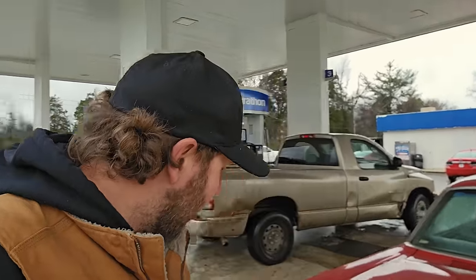Going pretty sweet. Headlights are hanging in there. Taillights are hanging in there. I just got to remember that these are hot wired to the battery in the rear. I got to pull the new headlight switch, but only to park. I can't go to full headlight because then we're feeding power both directions and things get all sorts of fritzy. It looks like a UFO in there blinking and all that sorts of stuff.